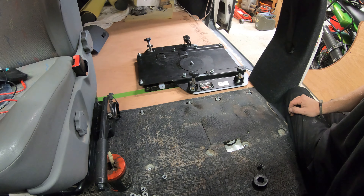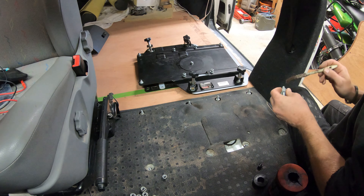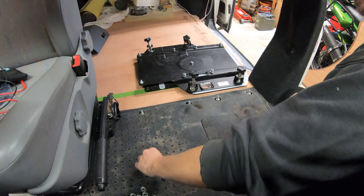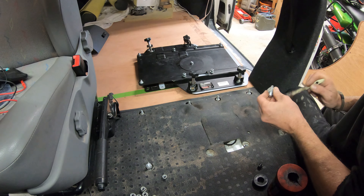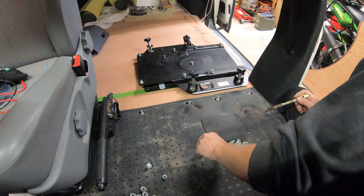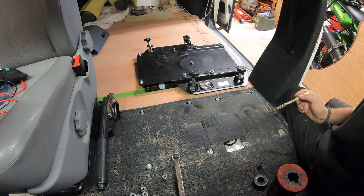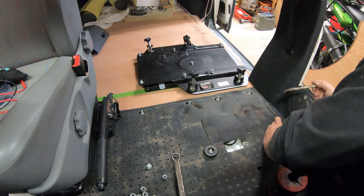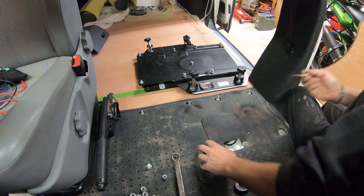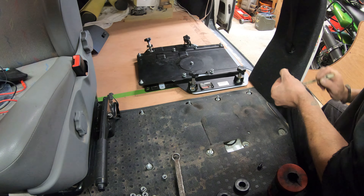Next job is refitting everything, and because I love copper slip I'm going to make sure everything's going back in the way it came out so if I need to remove it in the future I can. This is a 22mm spanner that you use to tighten these up or remove them. There are also some spacers — on that one there and that one there — which will go underneath the plastic. Just fit these back in.